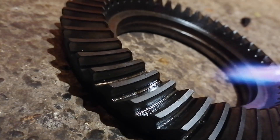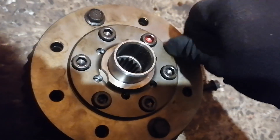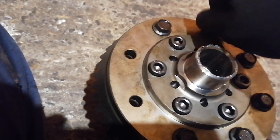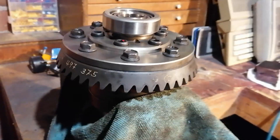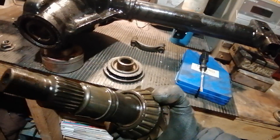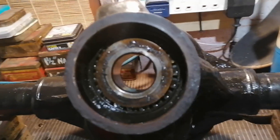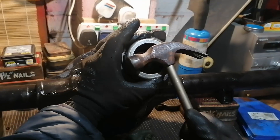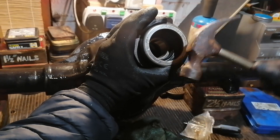Couldn't quite get the crown wheel to fit onto the new LSD, so I'm heating it up a little bit to expand the metal and then it just drops straight on. Using some high-strength stud lock from Sealey — it's also on my Amazon storefront. I'm putting those bolts back in the same places they came from. These bolts get torqued up to between 58 and 63 foot-pounds. Here we have the pinion, and this is the bearing with a seal — a new seal going in to replace the one that was leaking quite a lot on mine.